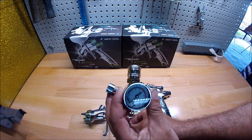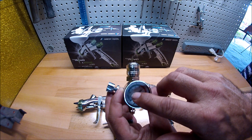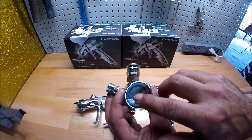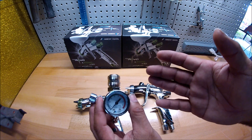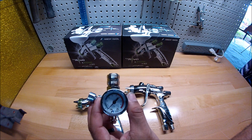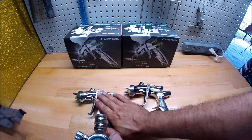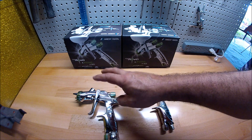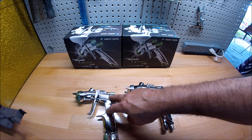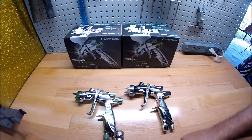For the air inlet, I use a regulator. For the paint I'm going to use 29 to 30 PSI — that's about two bar. That's already set up for the paint, and you can also use it for sealer or clear with the same setting.